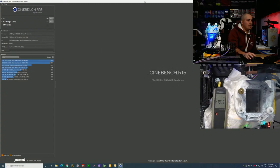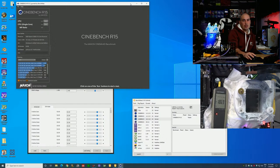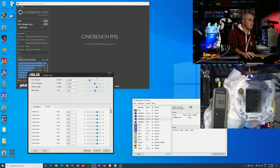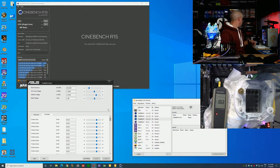The Kingpin, I think I was at 2250, something like this. So 2.25 gigahertz. But the Kingpin has a really custom-made BIOS that is not public, they gave me. And if you use the normal LN2 BIOS with the card, it throttled. I had to use a custom-made specific BIOS, and the card went from 500 watts to 600 watts, not throttling, and the score was like skyrocketing.